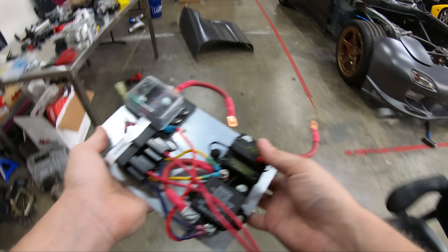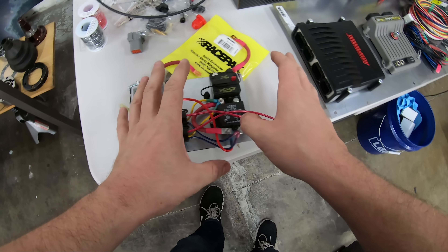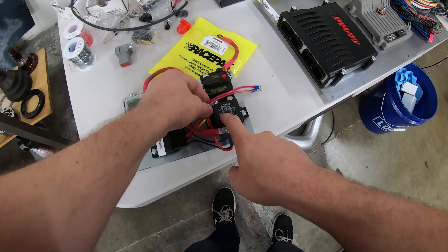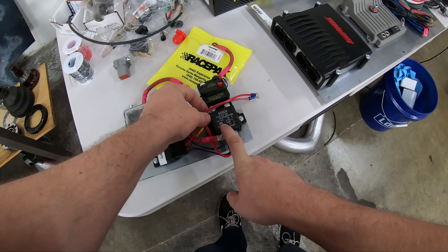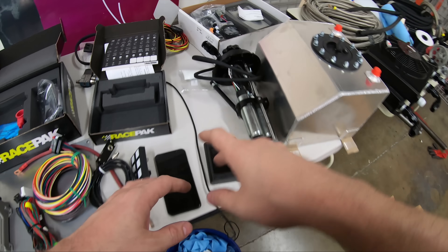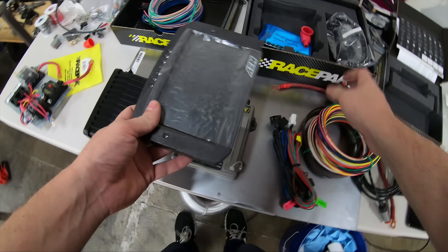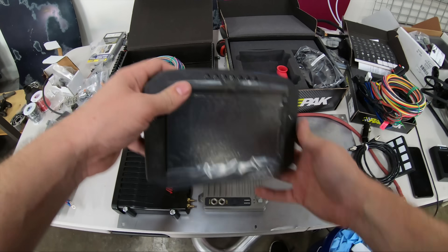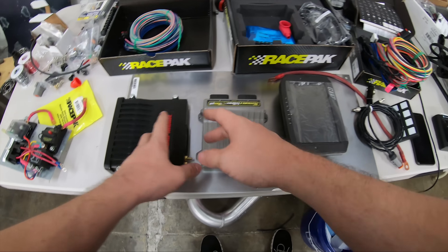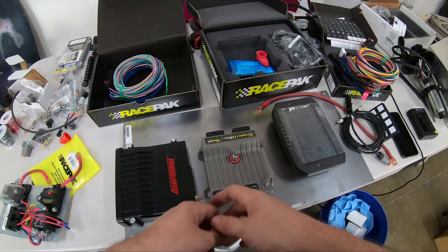Here's what I'm thinking for the ignition. This was the little thing I started working on for the three-rotor, and it's solid, but we can update this considerably. I'm going to have a relay for the ignition, and these bigger beefier relays can handle the ignition-level power we're going to need. We'll still have the ignition controlled by these two. The AEM Dash — this is very clearly meant to tell us humans what's going on inside these machines. That will run through a CAN bus to the Adaptronic. My wiring harness is set up for it. I will still mount that because it's going to be pretty awesome to see all of this information available at once.